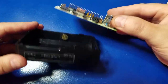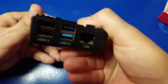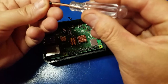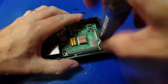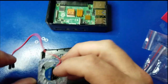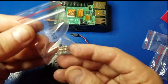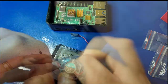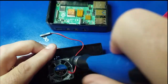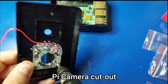Next, we'll install the Raspberry Pi 4 into the case. You just want to make sure all the ports are lined up properly — that looks pretty good. Once everything's lined up, go ahead and put the screws into the Pi itself. I used the darker ones here and a different screwdriver because I prefer mine over the one that's included. Next, align the fan to the studs on the case and go ahead and pop it in. To secure it fully you have to put in these screws, which I'm not particularly fond of — other cases just snap in.